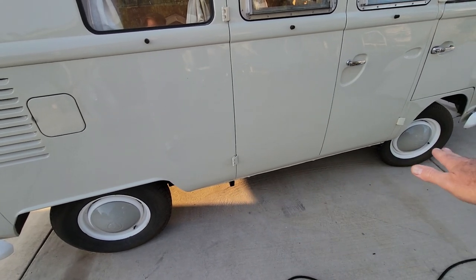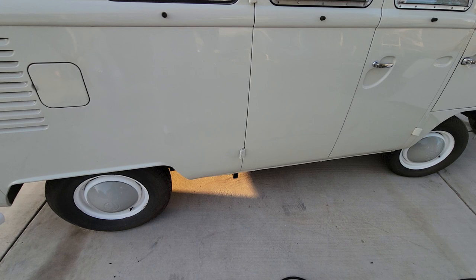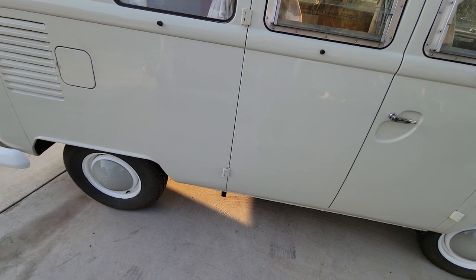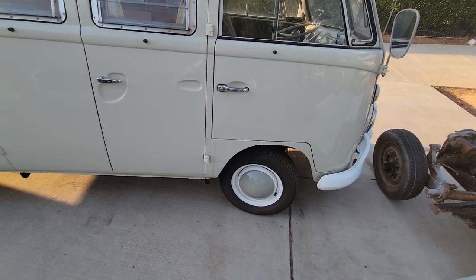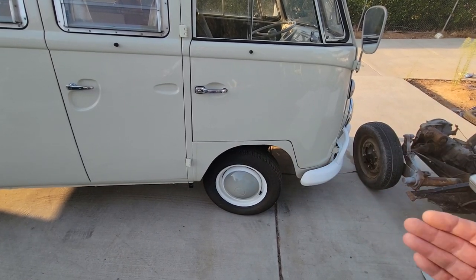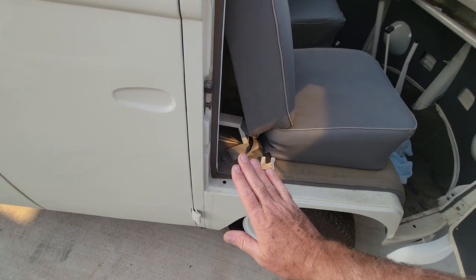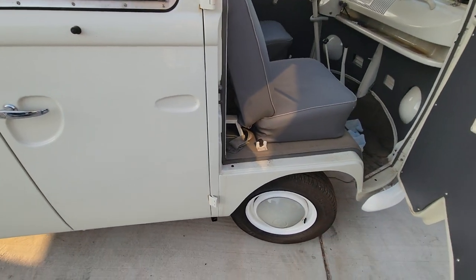These rockers are really cheap, so it's never really a decision to try and make those yourself — the repair panels go on pretty easily. But you can see it looks a little winged out because the metal quality is terrible. The orange aftermarket ones are really badly misshaped and I didn't want to spend time making everything fit perfect. On some things like dog legs, the quality is awful — they come welded so misshaped I almost wanted to grind off the welds and re-weld them. Also the inside is not protected at all, so make sure you treat that when you put new ones on.